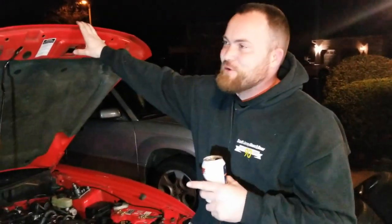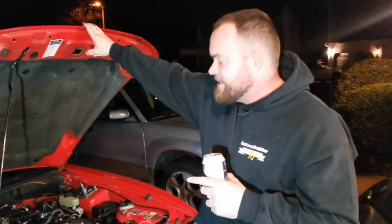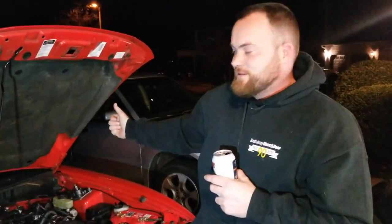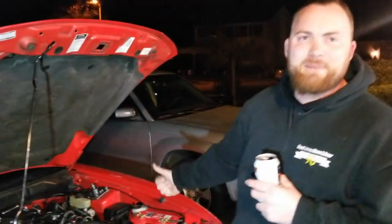It's where the second motor initially blew up. It was on the way to Ocean City, Maryland, and it did not make it. Well, it did make it down there, but on 6 cylinders. I got about 40 miles out, still on Route 1, and I got a little nitrous happy with a bullet. We all get nitrous happy. I left the piston ringland, the valve, and the valve seat in my intake. It went up through the head and back into the intake.